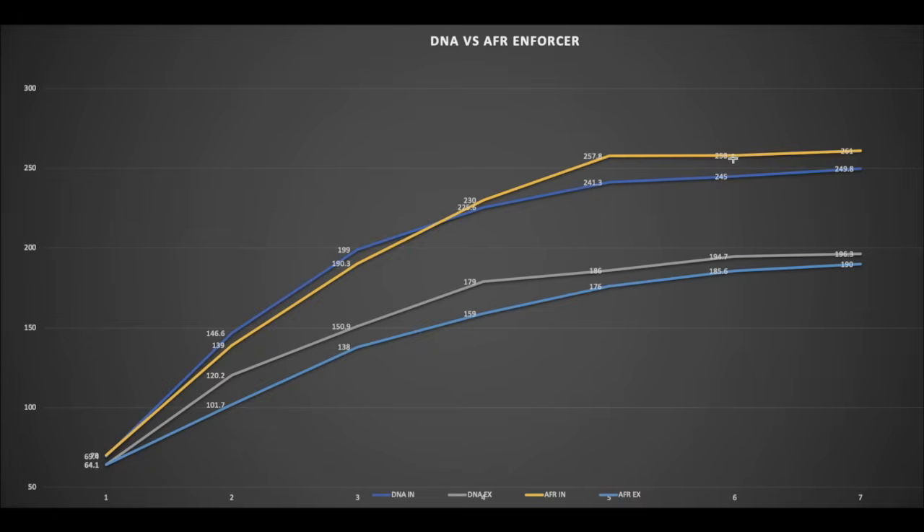Let me know what you guys think — is the skinnier stem why they're doing better up at high lift? Oftentimes a better valve job will show improvement down low, and then the port takes off up high. Is this the difference between a better cast port? Not a huge difference on the intake, though past 500 thou lift is where the AFR heads shine. If you ask a lot of guys, down low is what matters, so it really depends on what you're going for. Flow bench is just a tool for measuring airflow — a lot of guys get really worked up about flow numbers, but at the end of the day it doesn't mean everything.